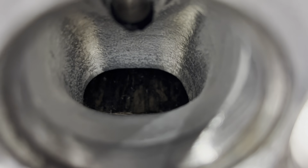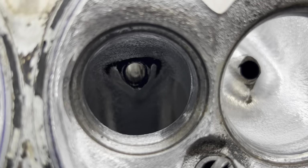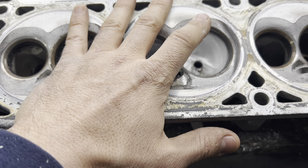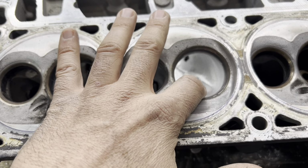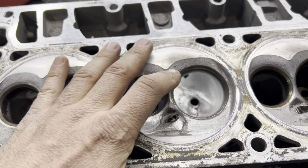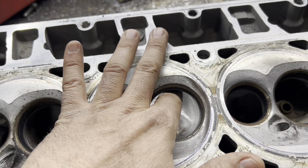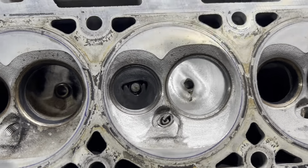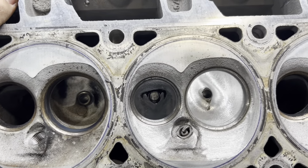This is just a basic, not an all-out exhaust port job. Basically what I want to do is digitize these ports. If I have a stock valve, the chamber I'm going to do by hand. I just want the CNC to do my port and the bowl, same over here. And then I can go in and do my valve job, blend it, do my chamber. If I decide to do a bigger valve, well, I'll do the oversize, and I'll correct the bowl area and the chamber by hand. I just gotta work out the details with the guy with the CNC machine, because it has to make sense price-wise for me, for him, and for the client.